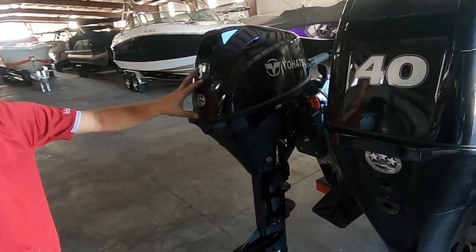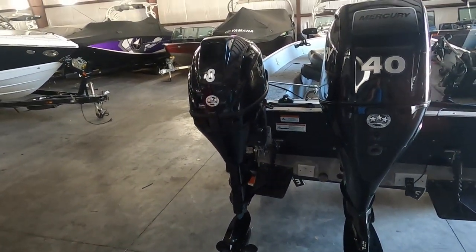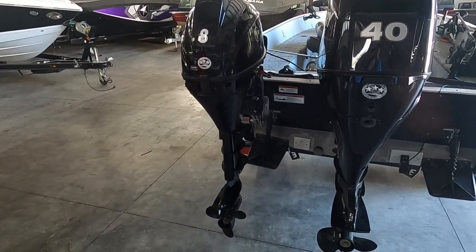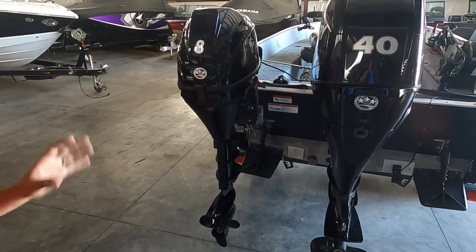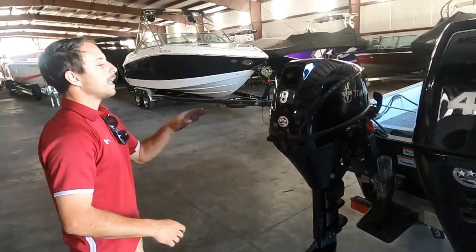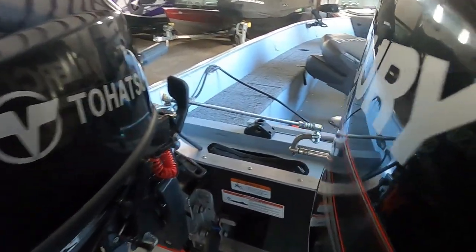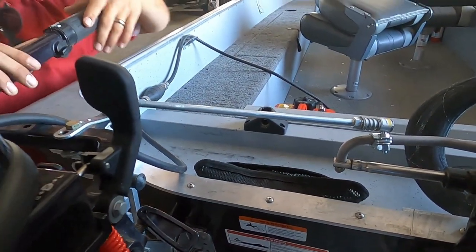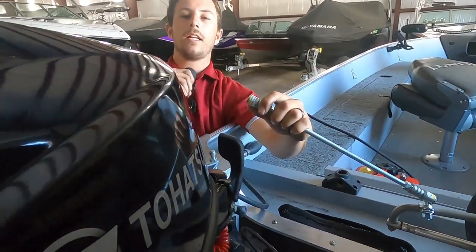Moving over to the kicker motor — this is an eight horsepower kicker motor. Typically you're not going to see a 1600 Fury have a gas-powered kicker, but for the previous owner it worked perfectly for his application. We're going to want to service this the same exact way — once a year, every hundred hours, and do the impeller in the lower unit every other year regardless of use. We did have a kicker tie bar installed so you can steer the kicker up front from the helm when you're steering the 40. If you want to manually steer it with the tiller handle back here, it's on a quick disconnect — you'll slide this back, that'll pop up, and now you can manually steer it.